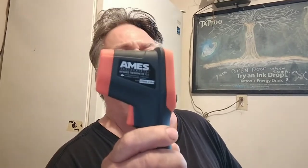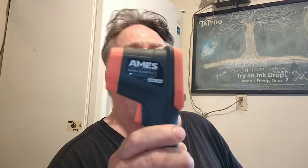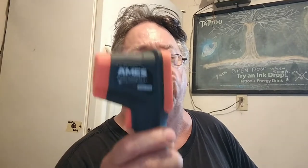Your refrigerator is supposed to run 38 to 40 degrees — 36 to 40, right? I open up the refrigerator door and I flash this in there. It showed me 38, so I'm good. It tells me it works. And also your freezer — I checked my freezer and see what it's running at just by opening the door and flashing this thing in there.